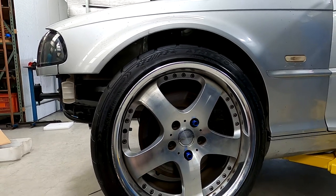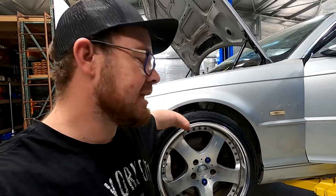Part of the problem is this strut isn't long enough. I can't lift the car to create droop because the strut isn't actually long enough to allow for that height. We're stuck because I also wanted to raise the actual static height of the car and I can't do that because it would get rid of that 30mm of droop. So dad's come up with a solution on the lathe — we'll go take a look at what he's done.